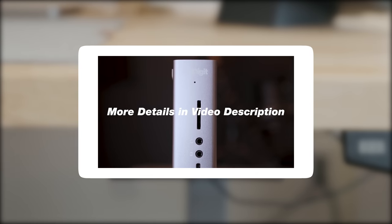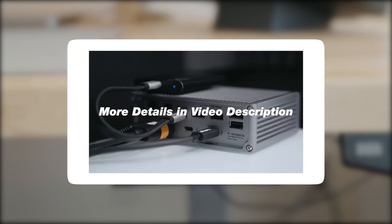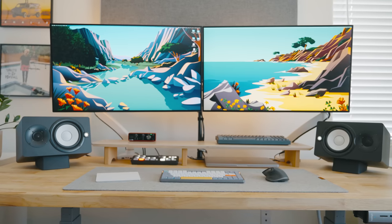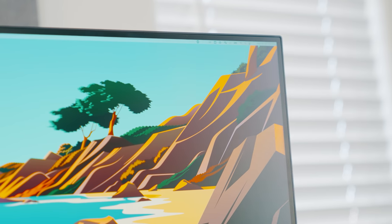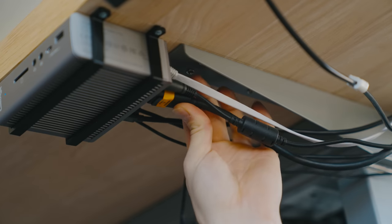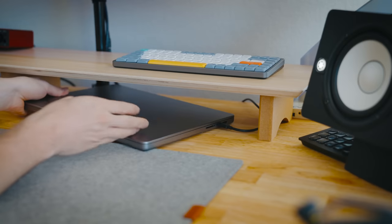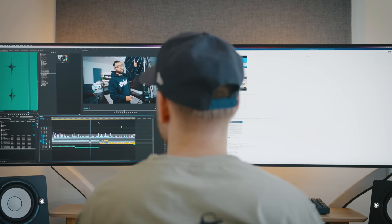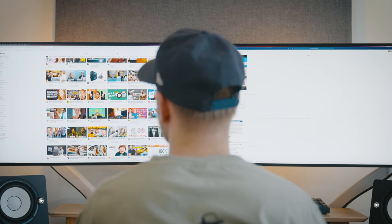The CalDigit virtually has everything I need: an Ethernet port, USB ports, SD card reader, and a DisplayPort. On my desk I utilize two 32-inch ViewSonic monitors. One is connected through the DisplayPort on the CalDigit while the other is connected straight into the MacBook Pro. If you connect the secondary monitor into the CalDigit, the computer will not recognize it.